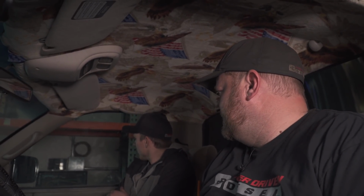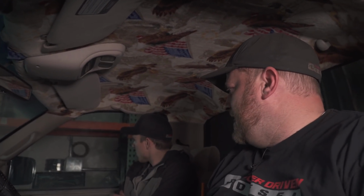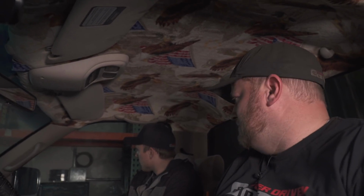403. That's within 2 horses of what the other stuff did, right? Didn't the other stuff do 401? 409. 409, so we lost power with more nitro. Now, nitro requires 3 times as much to make the same BTUs as alcohol. And since we feel like we're fuel limited in our detuned mode, that makes sense. We were just hoping the timing advance or the longer power pulse from that. So I think what's left is straight methanol, right?